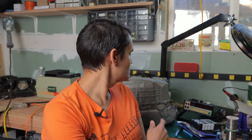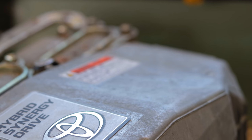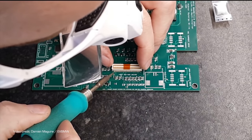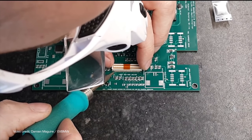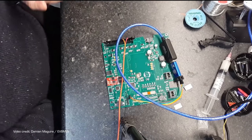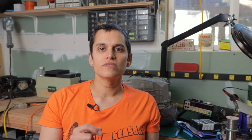So that means we have a couple of steps to take to get this all working before it goes in the car. First is to take this thing apart - we need to switch out the main controller for the open inverter board. That board needs to be built up a bit; it's mainly assembled when it arrives, but there are some parts that need soldering on. It'll also need programming. Then, while the inverter is in bits, I'm going to have to find the three underrated capacitors and replace them. Someone has posted a picture of them and where they are, but I don't have a spec for them, so until it's in pieces I don't know what spec the capacitors need to be to order replacements, which is going to slow me down a little.